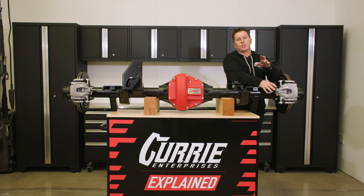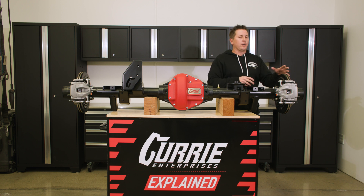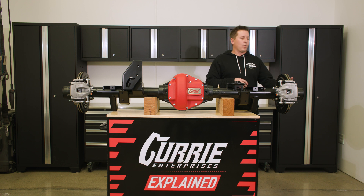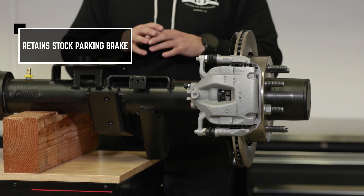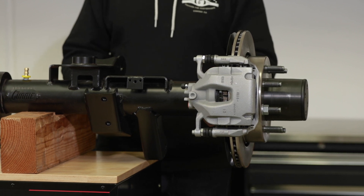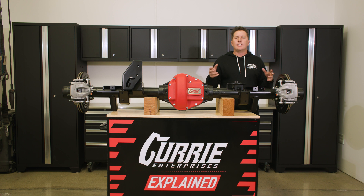Another reason we did this is that we didn't want the brake booster to have any different feel, so your pedal — there's no different pedal feel. One thing that we focused on, and we've learned a lot from the Jeep engineers, is the fact that the brake caliper and rotor basically go together as a great combination for the brake feel and for running big 40 and 42 inch tires. So we have a custom-made rotor that utilizes the stock caliper but is designed for our 8-lug and for the big bore so that we can use our hub. Another nice feature is the stock parking brake cables — there's no removing anything. You can literally bolt in the stock parking brake cables. It's a plug-and-play option with no adjustments and no having to pull lines outside the car or even get into the center console at all.